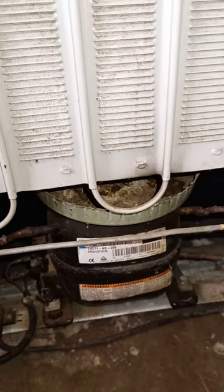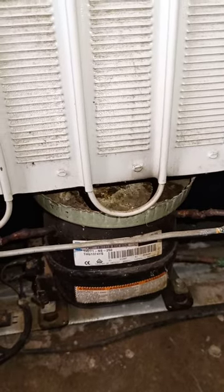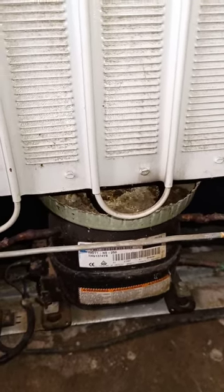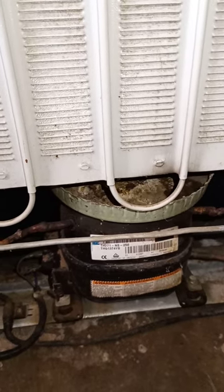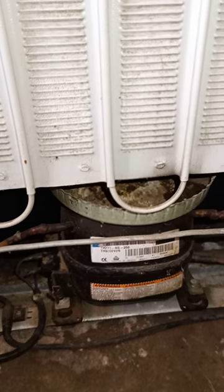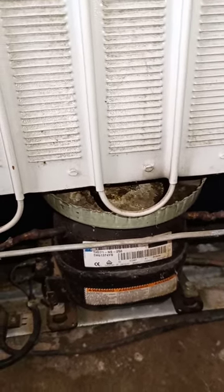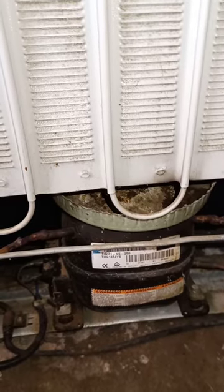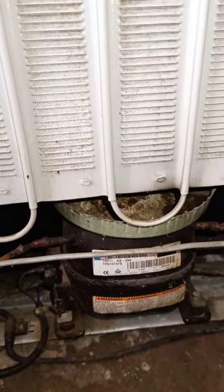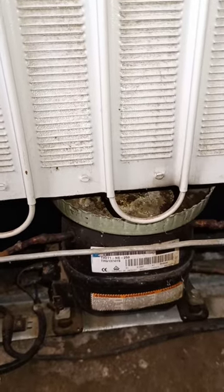There is no need to put gas, but if I want to I can also put gas — maybe 100 psi — and wait for 15 minutes to see if the gas is dropping. If that happens, then I know that my fridge is leaking, and I will have to replace the system of the fridge only with the cold plate. The system of the freezer can be repaired when it's leaking. The only system we cannot repair is the one on the fridge because it's enclosed in the body, here at the back.